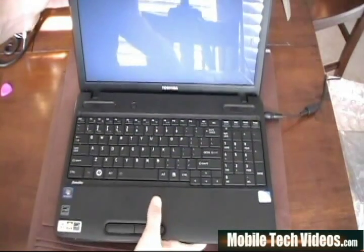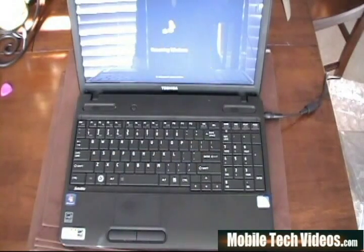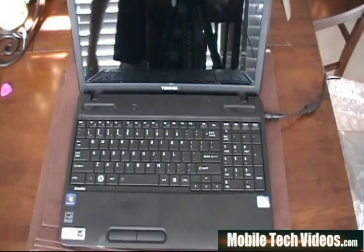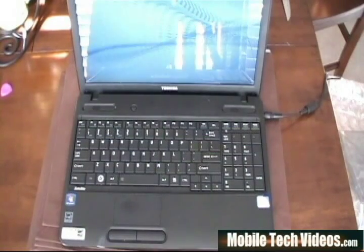Our Toshiba screen is working beautifully. I'm going to allow this to boot up into Windows. Keyboard is working — it allowed me to press that. We're going to boot into Windows real quick and perform our test with the keyboard and mouse. Make sure the mouse, the LCD, and the keyboard work correctly. If they do, power the machine back off and I'll catch up with you on reassembly.